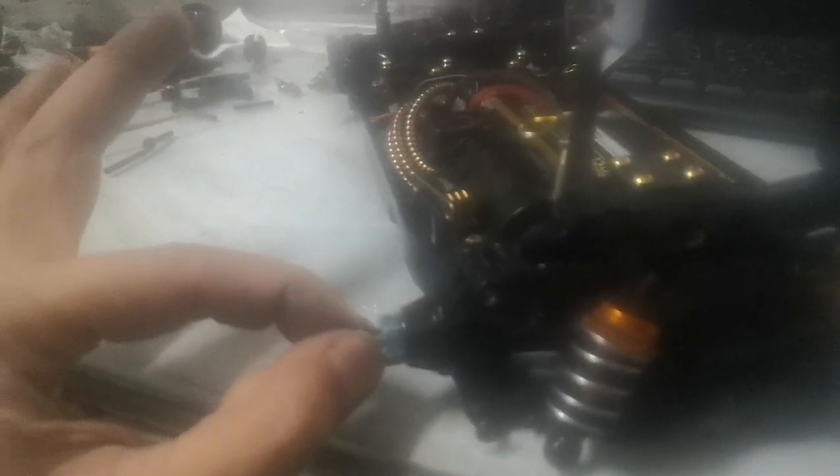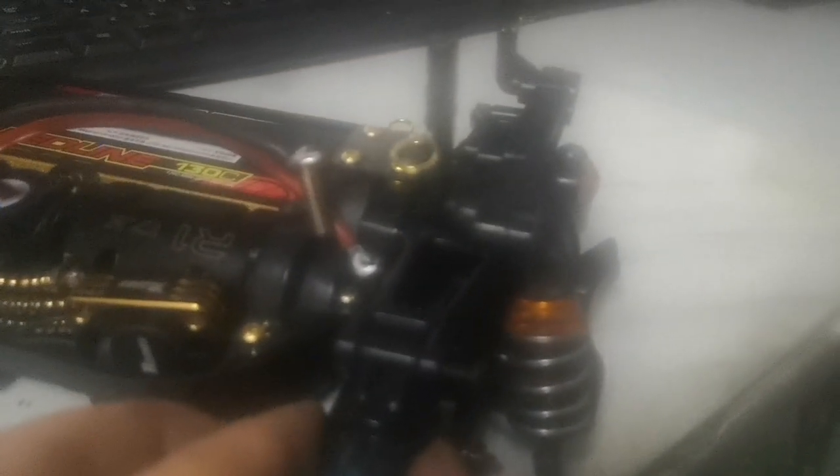On this side, you also want to make sure the rear suspension has minimal slop but is precise and free. In the hub, I use shims to make sure there's no back-and-forth play, but at the same time it's still free. I put maybe 0.3mm shims in here — it depends, so you have to build it, test it; it's time-consuming but it is what it is. No slop, no back-and-forth, but make sure it's free up and down with minimal binding.